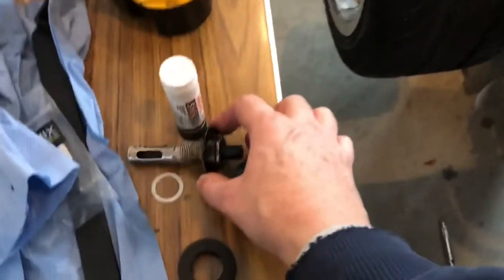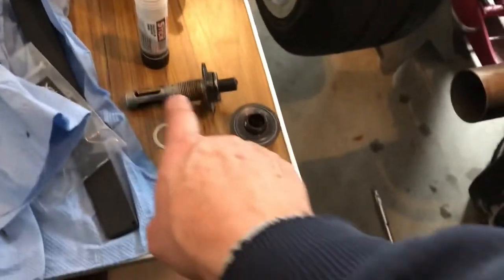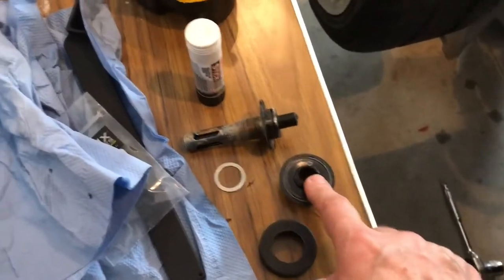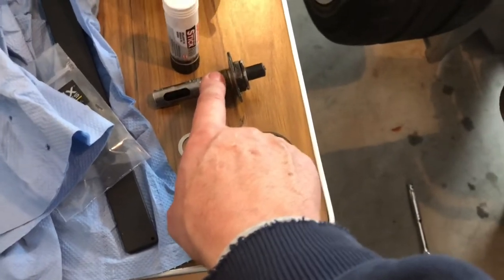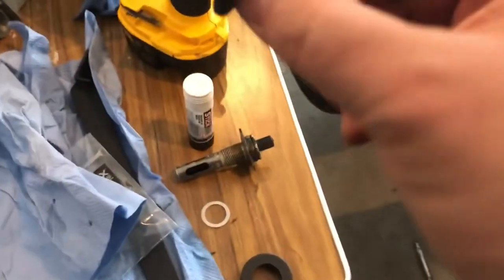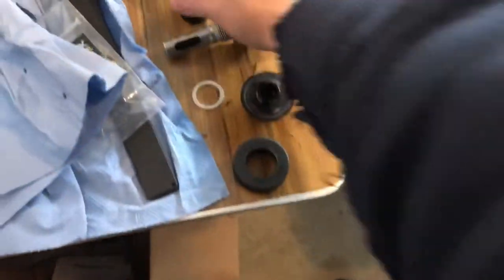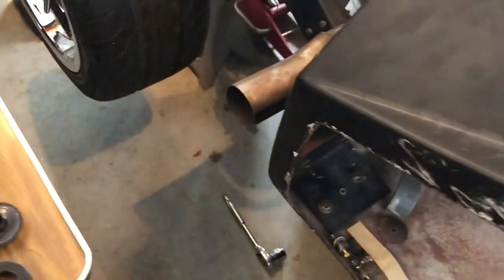I'm going to put the oil temperature probe right into the oil pan. There's a probe in the stock Mustang GT pan which they used, and that's how I can tell this was a GT — it came with the low oil sensor. I had to find an adapter going from the 20mm metric threads Ford used to a 3/8 NPT, which is what these probes use. I found this from Phoenix Fuel Systems for about ten or eleven dollars plus shipping.